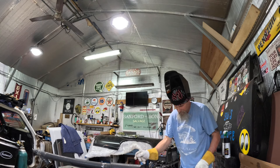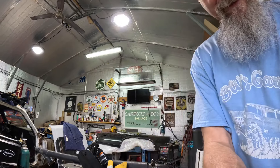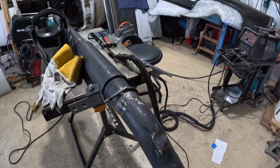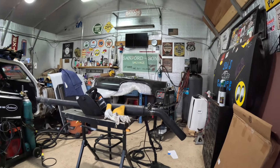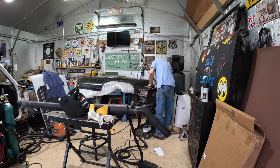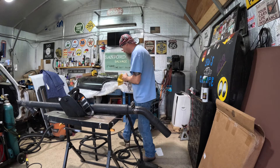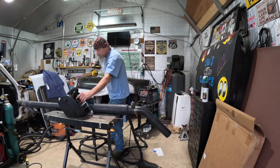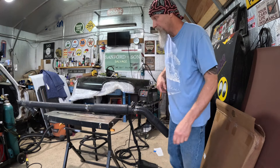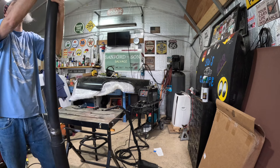That's good enough for what we're doing. I said there was a little undercut where I cut that old hanger off, and as soon as I touched it with the torch it popped a little hole so we had to fill it up. I'm happy with that. Now we just want to hang this pipe up on these wires and douse it with a little bit of that heat paint, get ready to put this thing on in a little bit. That side's still warm — what do you expect, we just welded it.